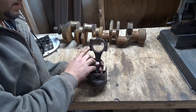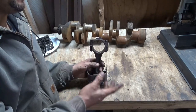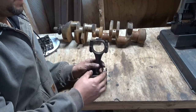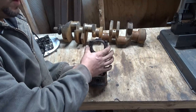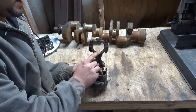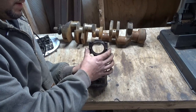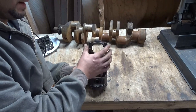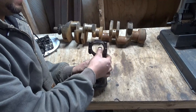Some people say you have to replace the rod bolts every time you get it rebuilt and resized. If you want to be professional and build a hot rod motor, I'm sure you could do that. But even in the service manual, nowhere does it say you need to replace the rod bolts or get them resized — it says to inspect them. I'm still going to say that if you see discoloration or it was knocking, then yes, you should absolutely use new bolts and get it resized.